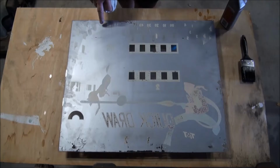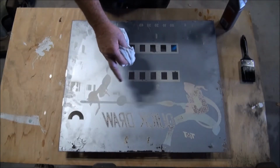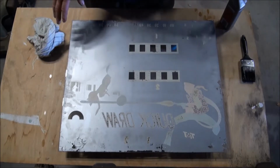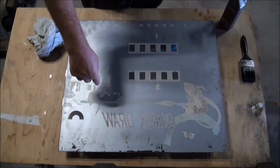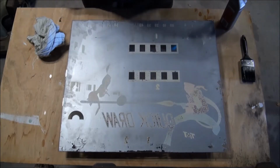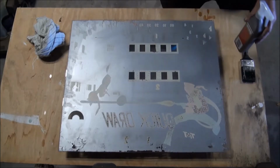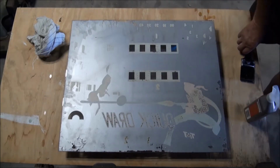Now, as for the rest of this glass, as you can see here, it's lifted off and it's cracked. It's peeling as well, same down here. If you ever want to touch up a back glass too, after you've done the Markseal and it's fully set, you can actually go around and apply paint to areas where the paint's disappeared, and the results actually are pretty good. I've done it many times. So let's get to work on this one.